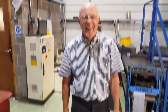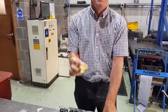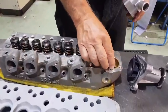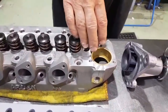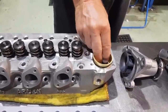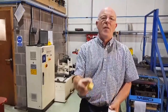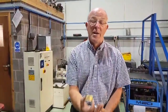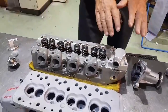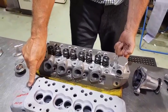On this nice eight-port head we've got here, it doesn't have a bypass, so what do you do? Big problem if it's a road engine. What we use is this — what we call a blanking sleeve. The thermostat comes out and the blanking sleeve drops in. What it does is stop the water surging out of that hole too quickly; if you leave it open the water literally rushes and gushes out and doesn't cool properly. So you need to slow it down — the blanking sleeve blanks the water off from coming out too quick. Now you don't have the problem of the thermostat being closed because it's always open, so you don't need the bypass hose.